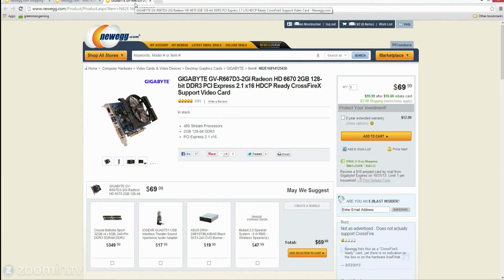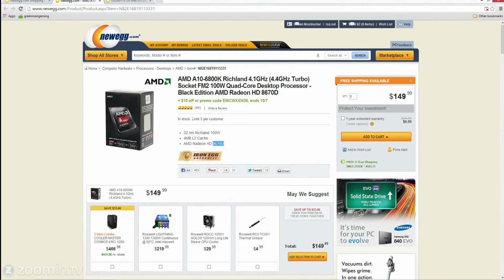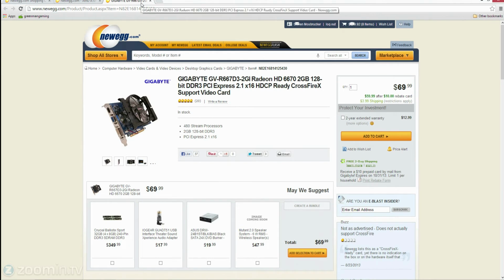Now, here, of course, you get to the bad part. Since the software is tying it between each other, and it doesn't have the speed of the PCI Express bus, right? So there are some issues with the software. You get some tearing and things like that. But that could be patched later by AMD. AMD's working on that now, so they will probably eventually be able to get that figured out. But very low power here, very great performance, and like I said, if you dual graphics these two, you'll get an extra 30 frame bonus.